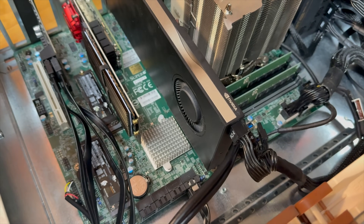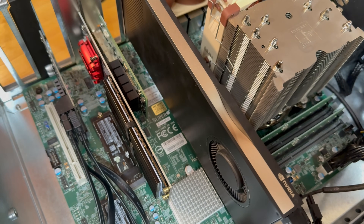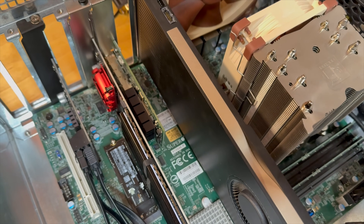It's worth noting that you don't need a high-end motherboard for this, and that really is the story here. A very simple $80 card can turn a single 8x slot into a dual NVMe solution, and in some cases that might just be what takes a motherboard from being just that bit too tight to meet your needs — which is what happened to me with the i5-13600K and Supermicro X13SAE-F. As long as you have that PCIe slot available — either an 8x or a 16x slot — you don't need any special BIOS stuff. It just needs to be an electrical 8x slot, because this controller connects back to the chipset or to the CPU at 8x with eight lanes.